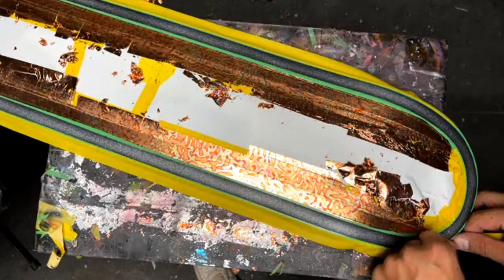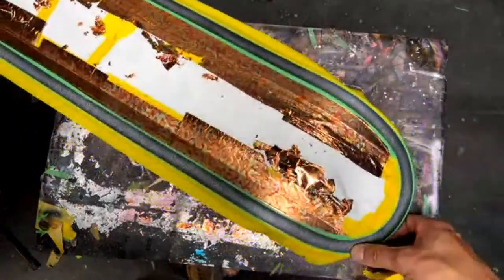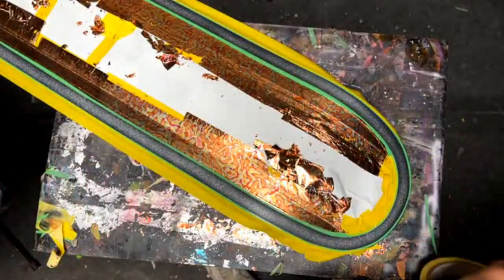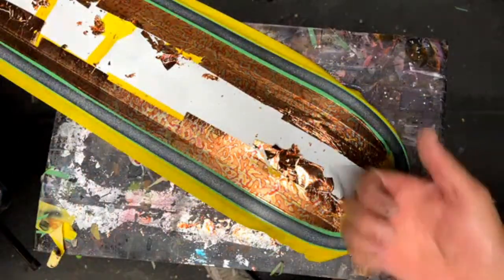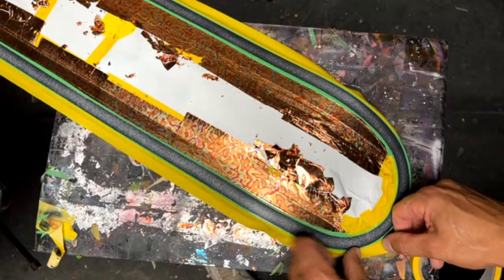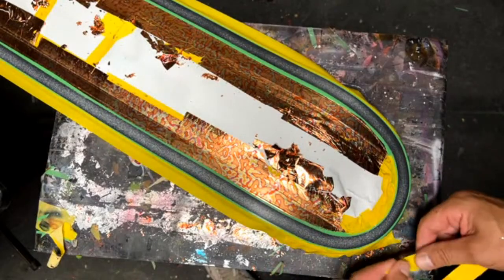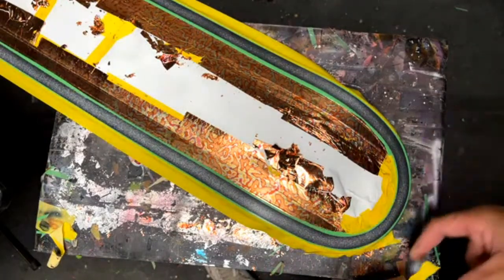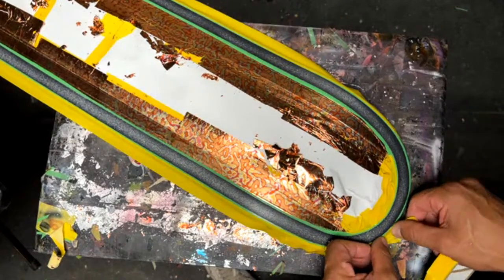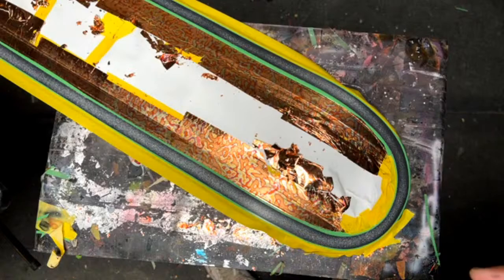Also, and I really should do a video on clear coating and using the gun. If you're clear coating small parts, you can feather the gun more. You don't need to go full trigger on, full trigger off. I know a lot of people are taught that way because that's how you paint cars. You need to get around them quick because you have a wet edge. You need to get all the way around the car and meet up with that area to make sure it all blends together.